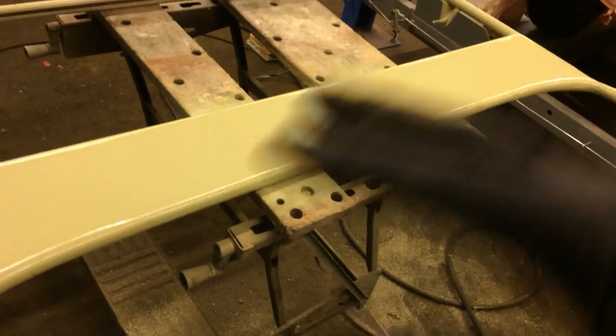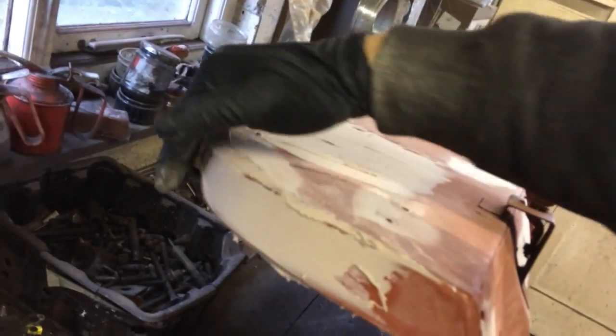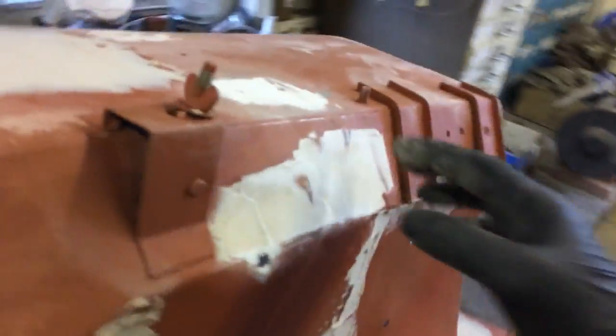the red oxide prevents the steel from rusting, metal. And once you've done that and you have it red, like that piece there, then you start filling it, if it needs filling, if it has a few dents. Like this, for example, here we couldn't beat it out, so I fill this in and now I'm going to rub it smooth. Once you finish that, that's when you do that paste.